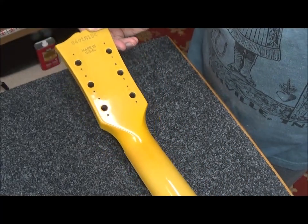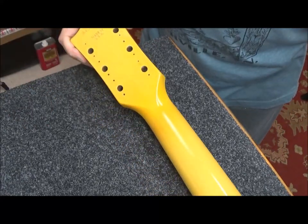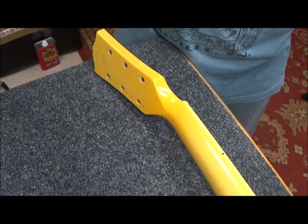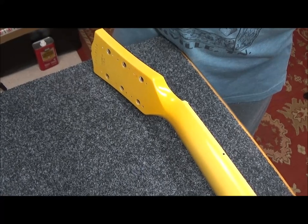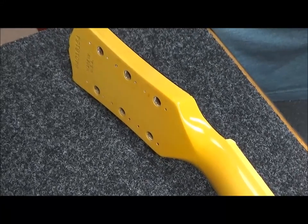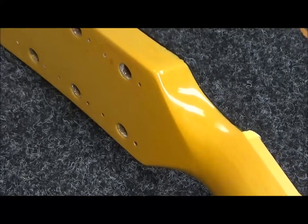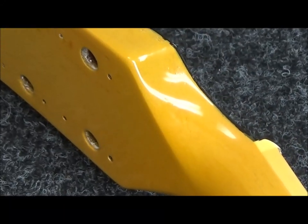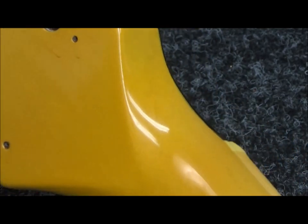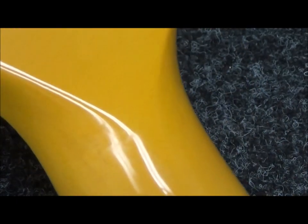I went ahead and wet sanded it. I think I waited 3 weeks to let that nitro gas off. And I wet sanded with 800 grit through 7,000 grit. I didn't have any 5,000 grit in the water, so I skipped 5,000 and went straight from the 3,000 Trizac pad to 7,000, and then I did the two compounds.